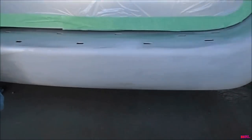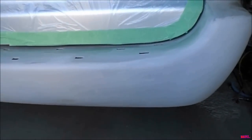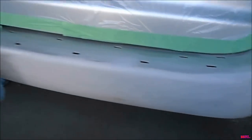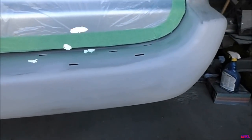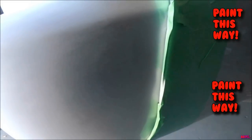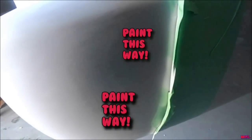That part two is this bumper. I didn't do anything to it — this is the way I got it, but it ends here. They definitely want to paint the whole bumper. First step is to make sure it's totally spotless and clean. To alleviate that situation we need to make a soft line, but this is a really poor example and it's kind of hard to do on a bunch of curves. I want to get this thing out of here in an hour, so on a really good car you'd want to spend more time.